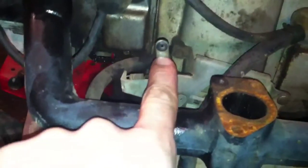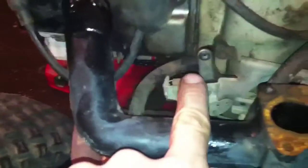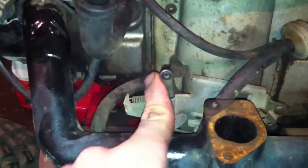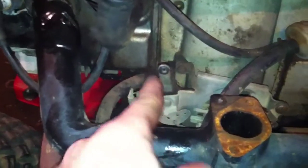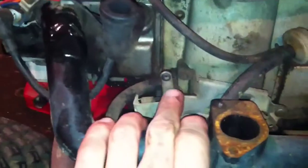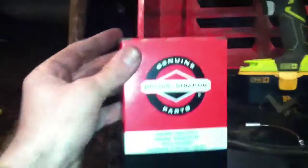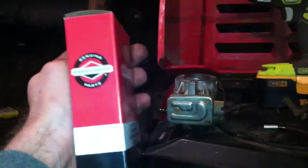You can see right here - this is the governing rod. I'm going to drill a hole in it right here, right below the carburetor linkage, and drill a hole in the bolt too. We're going to run a cable from this cable mount down to here, and it'll pull this way - so that right there is throttle closed, and pulling it this way is wide open throttle. As you mash the pedal it'll pull it wide open.